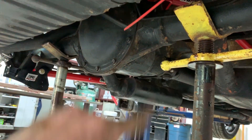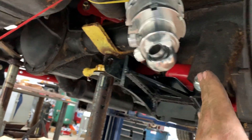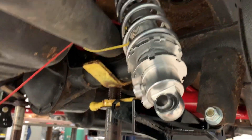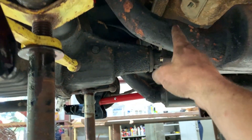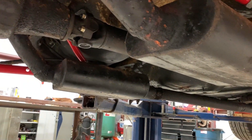I was getting to the suspension preload and getting it mocked up, but the unfortunate thing is the exhaust pipe - the way it's routed up and over, it comes too close to where the coilover needs to travel down. From where the original shock mount was to where it mounts now is right in line with the exhaust, and it's the same on the other side. So without the exhaust pipe moved, you won't be able to put on the coilover. Best bet is probably to move that piping closer to the drive shaft and maybe do turndowns.